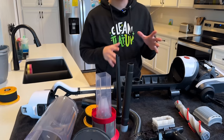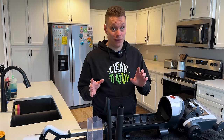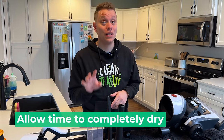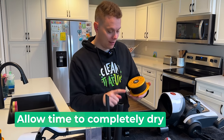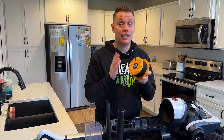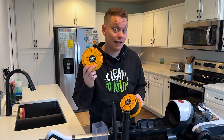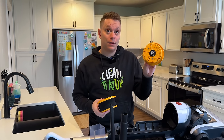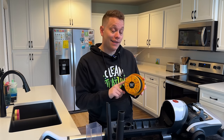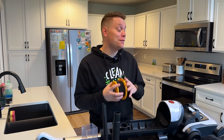Everything is nice and clean — we're just waiting for the pieces to dry. If you've ever noticed your vacuum has a musty or moldy smell, it could be caused by putting it back together too soon before everything is completely dry. This is a really important step, especially for the filter. On this specific one, it says air dry for 24 to 48 hours, so before you lock it into the machine, you want to make sure it is 100% dry. A pro tip: have a second filter on hand so when you're cleaning this one, you still have another filter to pop in. Keeping the filter clean on a regular basis is key to not having a stinky vacuum.